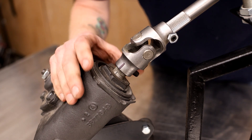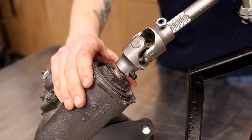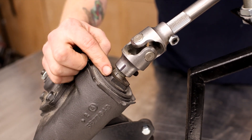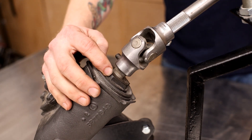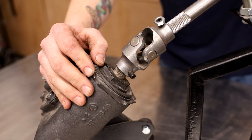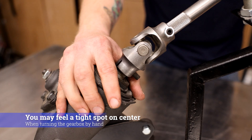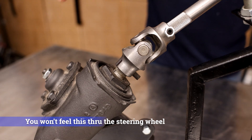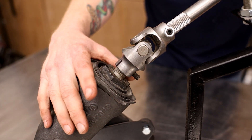So what we're going to do is turn this back all the way over here, back to our second mark that we made — that's one. Then we're going to go ahead and turn this all the way back to about seven eighths, which will be really close to dead on center. But here's the trick: it doesn't have to be exact. You don't have to be within a couple of degrees for your gearbox to be centered.